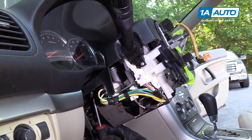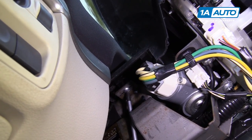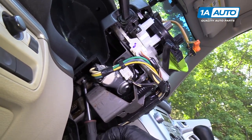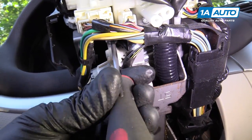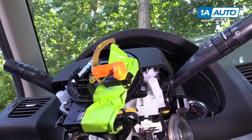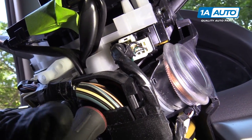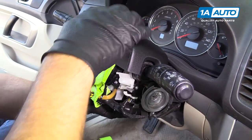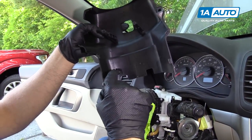I'm going to pull the upper cover off. There's a little Phillips head screw back here — it's kind of hard to reach, so it's good to have a long screwdriver. We have the adjuster down while we're taking this out, just to access the screw a little bit better. There's another hidden screw right here — loosen that up. Take this one out with our Phillips head screwdriver, and it looks like there's another one right here. Pull this one out as well. I'm going to lower the steering column and pull this right up — that's where the three screws mounted.